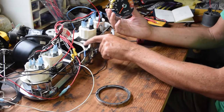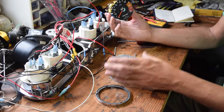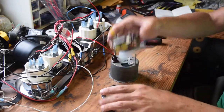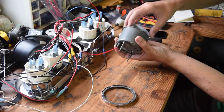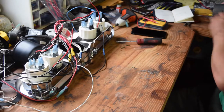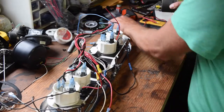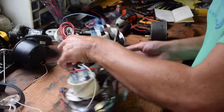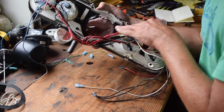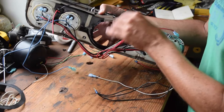And then as far as my mounting solution goes, the outside casing of this tach is almost the perfect size to just fit right into this backing plate that I'm using. So let me put this back in here. The way I have this set up is, here's my bezel, and in the center I came in with a Dremel, cut some slots around here, and then folded this in mostly uniformly, so that the tach slides really snugly right in here and holds it in place. I don't need any other brackets.